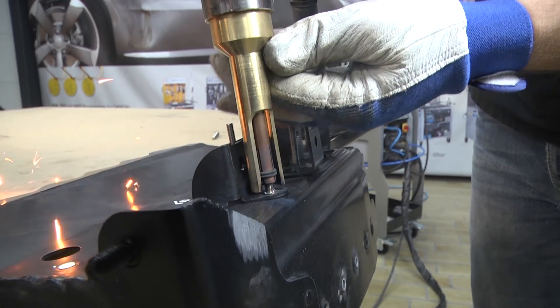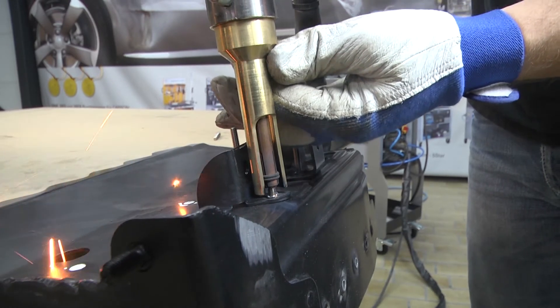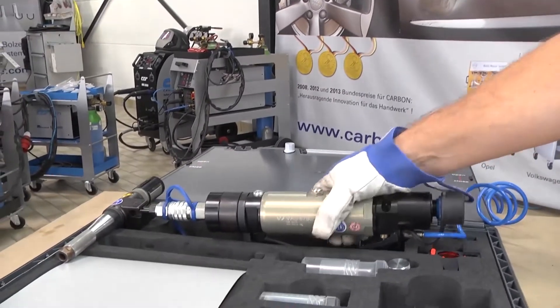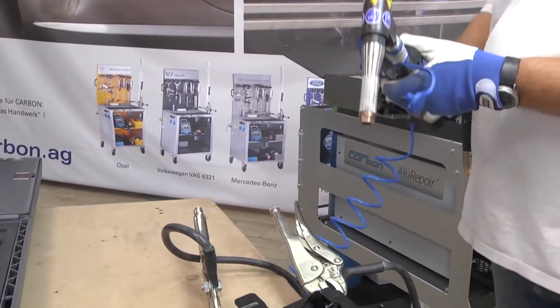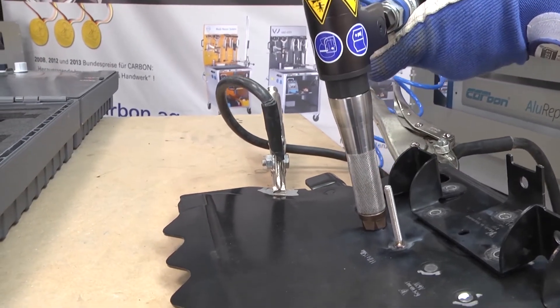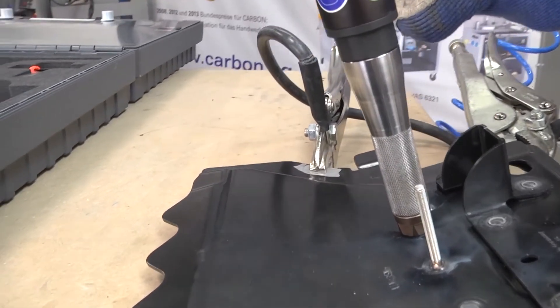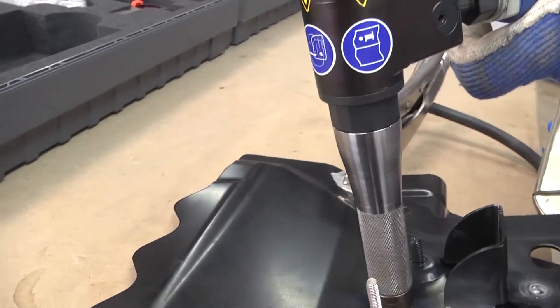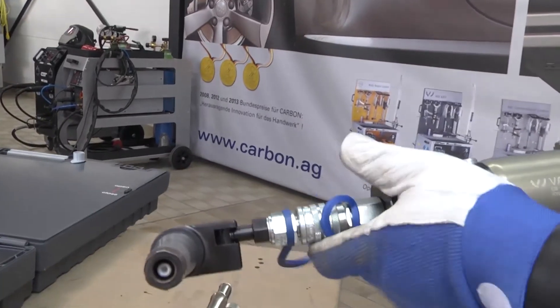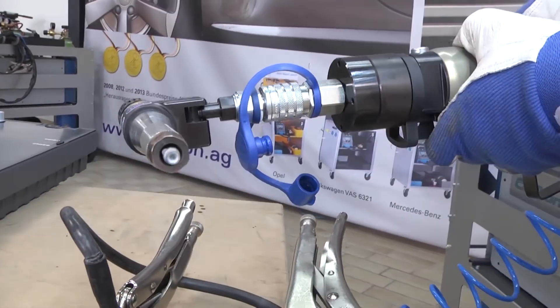You can also see clearly how the bolt cools down at the edge of the weld. Once the weld has cooled, you can pull out the rivet together with the bolt. We use the Audi special rivet device — the VAS6792 compact rivet device with a VAS6792-2 extension — which applies enough power when removing punch rivets to remove them from the material in one pull.